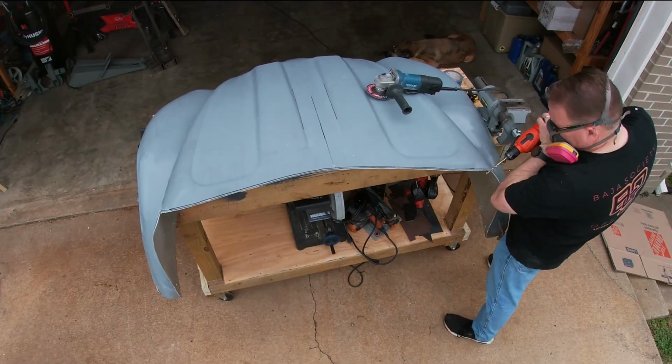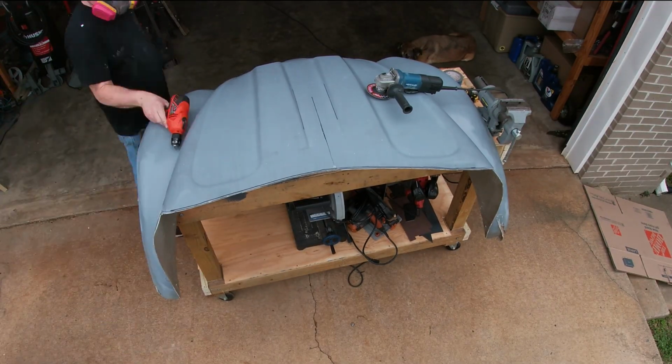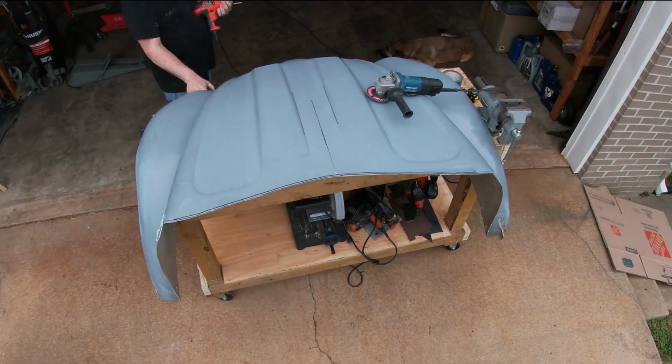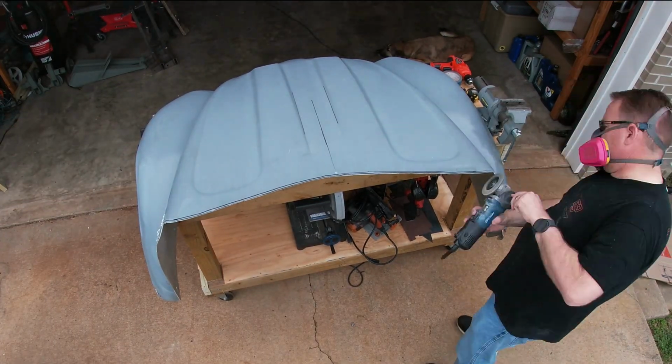And with that, it was time to do the finish work, those fine trims that will bring it all together. I actually ended up drilling out some of the little points in the fiberglass where I had to come in and make a sharp point. I once got a pro tip that you never want to have a sharp point in a fiberglass piece. You always want to drill it out and then run the cut to it, so that little round hole from the drill will keep the fiberglass from cracking and splitting apart in harsh terrain.